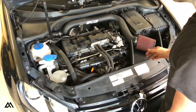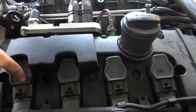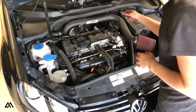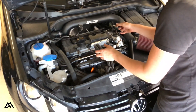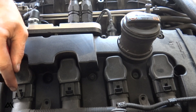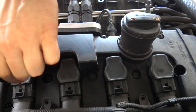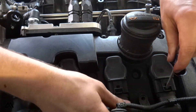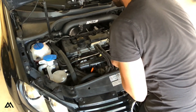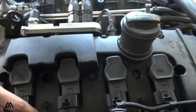The first thing we're going to need to do is take the clip off of all the coil packs. The lines running into the coil packs are all connected with a hard case assembly. You're going to need to disconnect each clip first before pulling the whole assembly back. Just get in here with a little screwdriver and pull this back like so. Now that all of the clips are disconnected, you can pull this whole assembly back and get it out of the way.